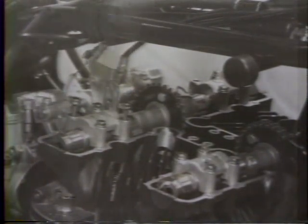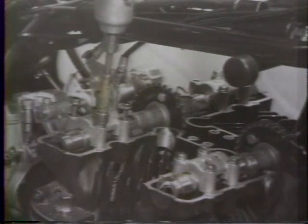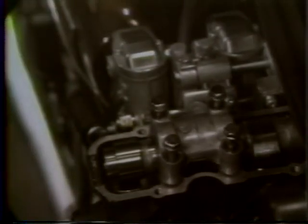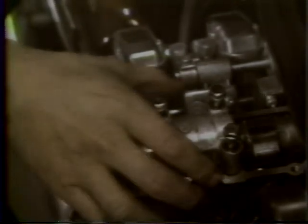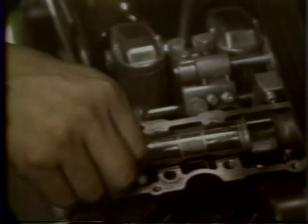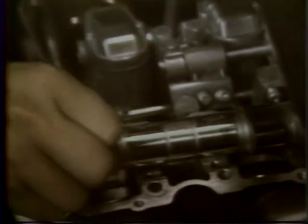Then take the bolts back out, remove the shaft, and measure the clearance using the plastic gauge table. If the clearance is excessive, the four bushing halves for that camshaft must be replaced as a set. No used bushings must be used together with new ones, and if the old bushings are still usable, they must be put back into the same place they were taken from.